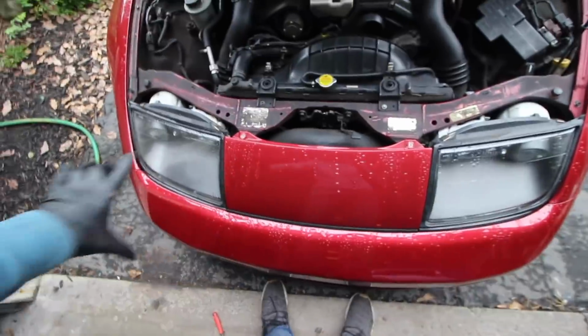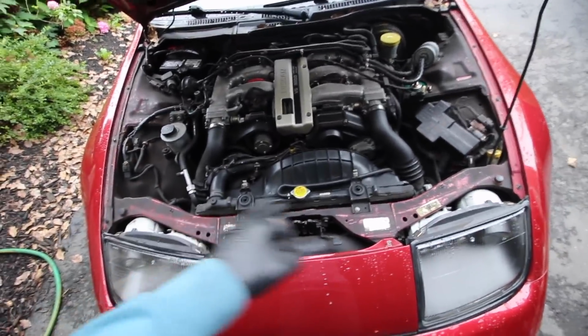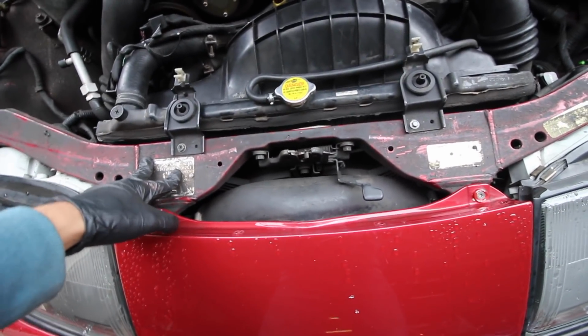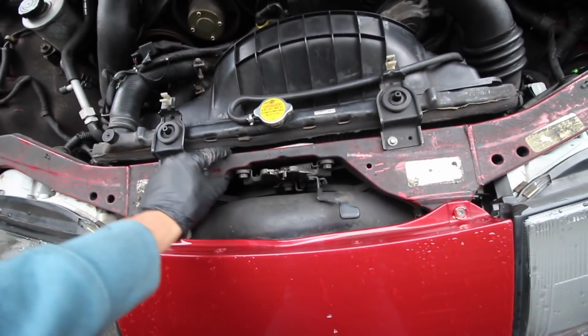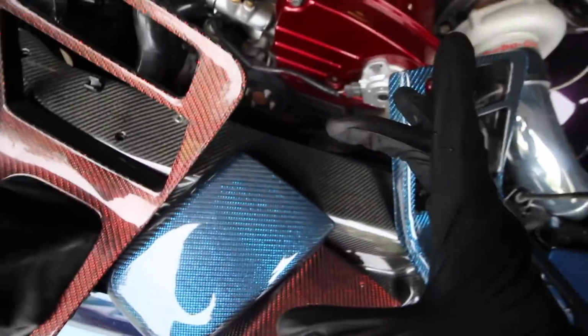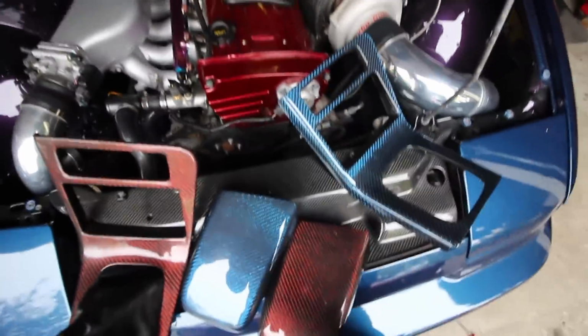I've already got a big dirty 4-inch intercooler for this thing, and a universal piping kit that I'm going to use to make our own piping. Radiator is one thing I still have to figure out. I'm debating whether to do the tucked radiator, but I don't know how that would work because there isn't much room. On mine, sorry, all the carbon fiber is in the way, my radiator is under here, and it's a super thick Griffin universal radiator, about three and a half inches thick, I believe. Huge. It keeps this thing cool like an absolute champion.